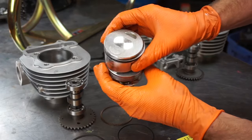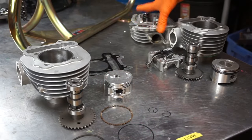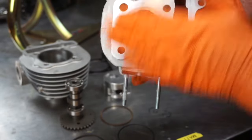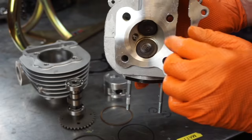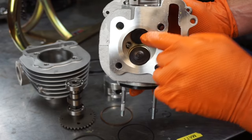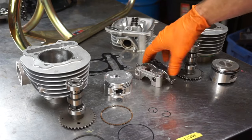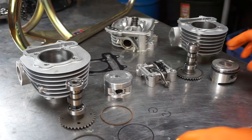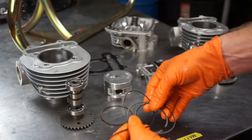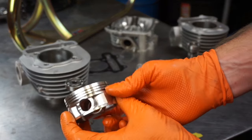Here's our old piston and here's our new piston — a little bit bigger. We're going to reuse our cylinder head, which I like to do because it adds more compression. When you get a larger cylinder head it cuts out an area for a little bit less compression. Although you can get heads with larger valves which makes a difference, in this scenario we're using the stock head. We'll also reuse this cam tower.